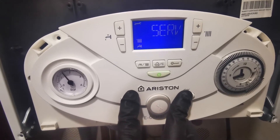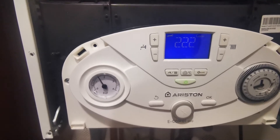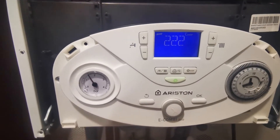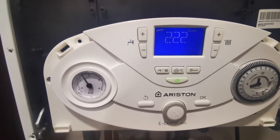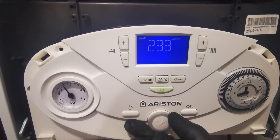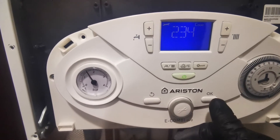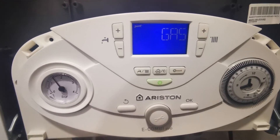The circular spanner button — around that are two buttons, left and right. Hold down those two buttons until 222 appears on the screen. Once it does, use the spanner dial until you get to 234, and then push the right-hand side button, the OK button.